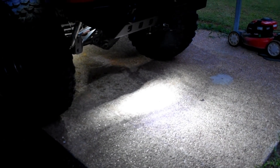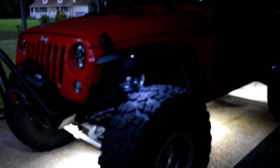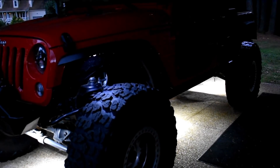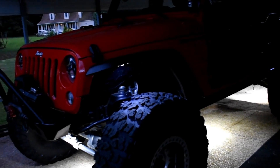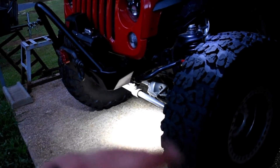It's finally dark enough to turn on the rock lights and get a decent view. Those are the little bolt lights I mentioned, and underneath are the pod lights — I have three of those mounted underneath running to a switch on my pillar and a relay and fuse under the hood. They put out decent light output and I've been happy with them, but I've had a lot of requests to make a rock light video. My DIY setup was around 60 bucks; the Aux Beam kit is 75 dollars, and honestly I think it's a better bang for the buck, especially with the ease of install and the color-changing options. Tomorrow I'll do the install and that night we'll compare them side by side.